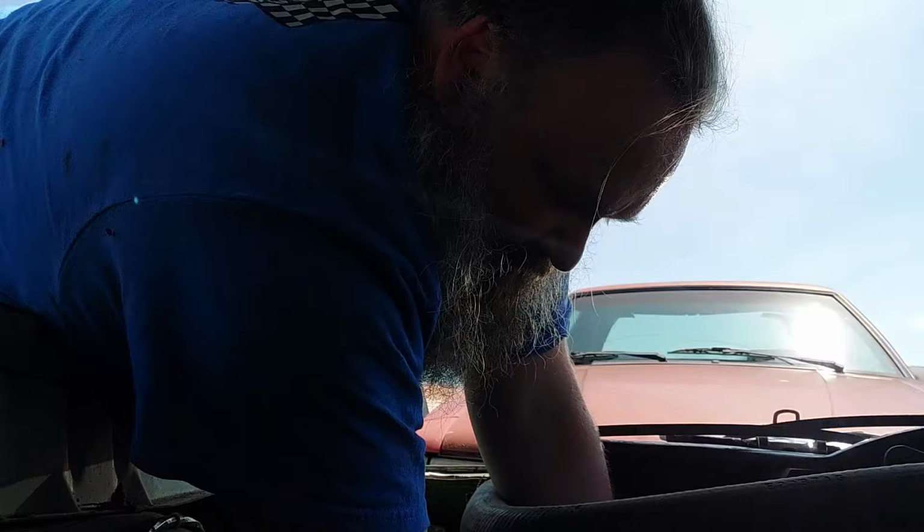Good enough. All right. Fuel pump officially installed. All right, so fuel pump is installed. Now the question is going to be, how do we want to feed this thing? I think I'm going to go ahead and reuse the inline filter, even though I don't really want to. That way I can see whether or not it's spitting fuel up. I'm going to pull directly out of the tank. So I'm just going to worm clamp a 3/8 inch hose onto the feed line.